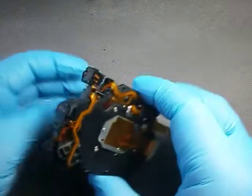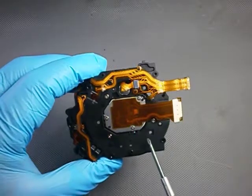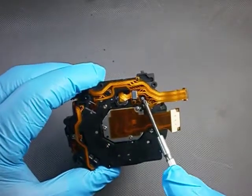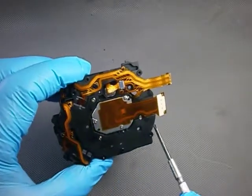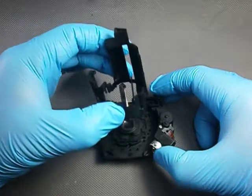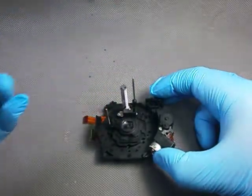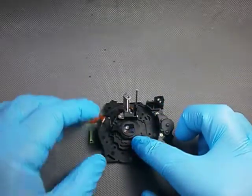I had attached a plastic support to the back plate but will have to remove it again to give better access to the focusing lens and sensor window. I had removed all six screws around the sensor, but later realized that only three attach the back plate to the lens assembly — the other three just hold the plastic support. Remember, this is not a step-by-step DIY video. If you try this with your camera, you do so at your own risk.